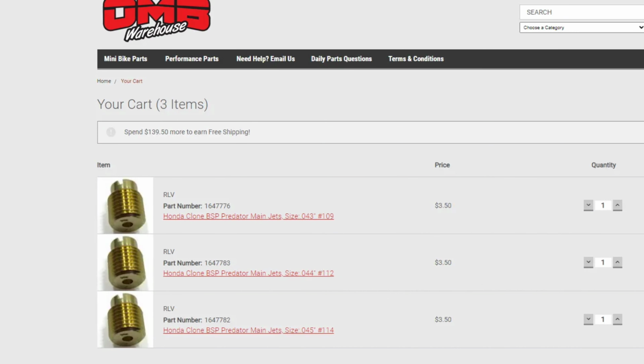So, I think at this point we need to order up a bigger jet. I think we're flowing way more than what those two jets are capable of. That, or I need to pick up a drill kit and we try to do it that way. But, as you can see, the filter made a giant difference on how well it ran. That's something to keep in mind when you're dealing with this kind of stuff. You see that a lot in older single-cylinder Briggs & Stratton flatheads, where the filter makes all the difference on how it's running.